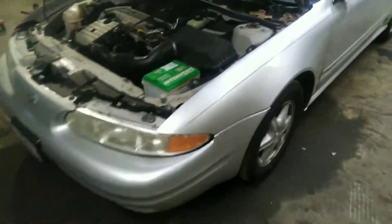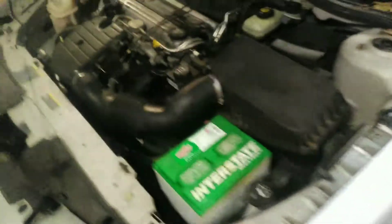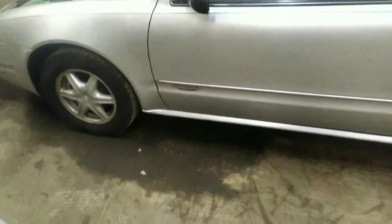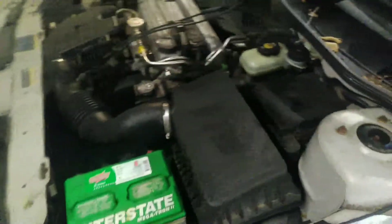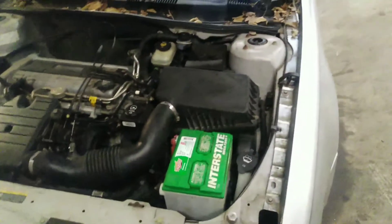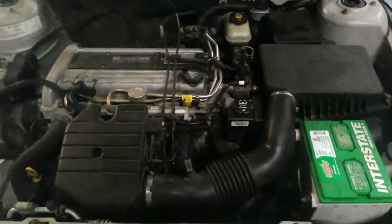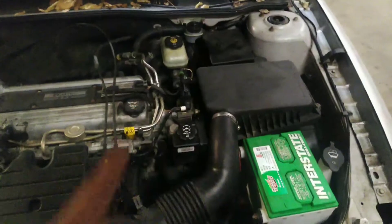Here's an update on what we've done so far: all new brake lines, all new calipers, pads, and rotors. Everything's bled out, fluid coming out clean, no spitting or air in the lines front or rear — all four corners. And still no brakes. I had to pump the brakes up a few times to get it to stop. When I was driving home there were no brakes at all because that line was blown out and the master cylinder was empty.